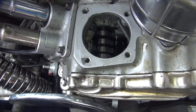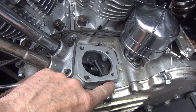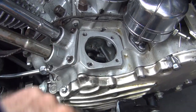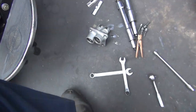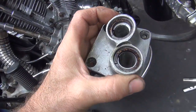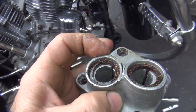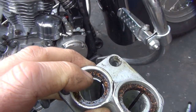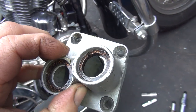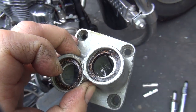Inside the motor everything looks okay. There's a little nick in here we should take care of. He's got aluminum lifter blocks, correct for a '49, and they all look fairly good. But what I found is each one of the corks has a slit in it right here — one slit on this one, and a fine one on this one over here.